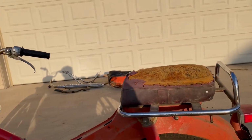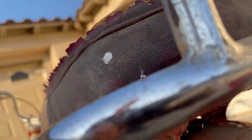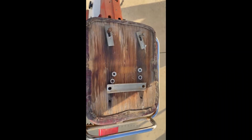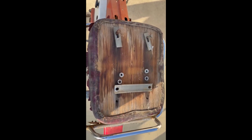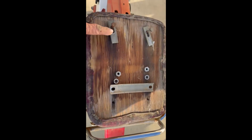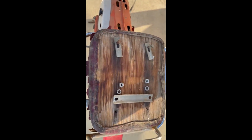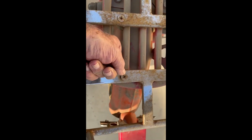All right, next I'll take this buddy seat off, and there's a couple nuts on the bottom to take off first. I don't know if you can see it or not, but I'll show when I get it off. All right, this is what was holding the buddy seat on, but I'm not sure this is really Honda. This is probably aftermarket. This was a 14 millimeter. This is some SAE size, Imperial size. So probably not Honda. Anyway, that's the seat. And those two nuts are on the bottom of these two screws here.